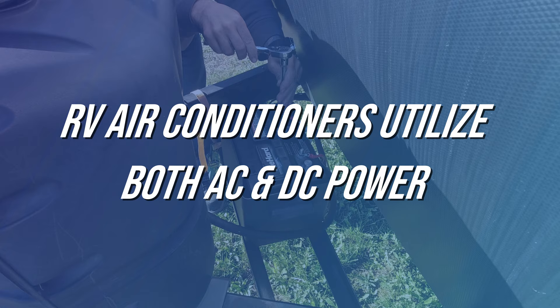And just a tip, guys: anytime you're removing a 12-volt battery, always remove the negative terminal first.